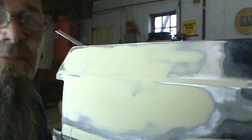Can you guys see this tape line I got on here? See this tape? It's almost the same color as the Bondo. I put my straight edge down the curve, drew a pencil line, and put some tape there. Now when I go to block, it's giving me a body line. Anyways, there's the tape right there and there's the bottom of it. So that's what I'm doing right now.